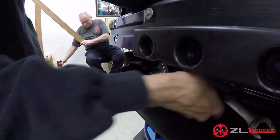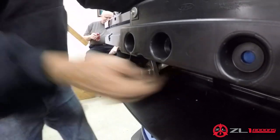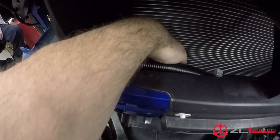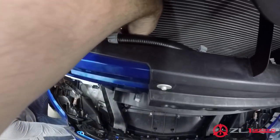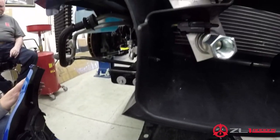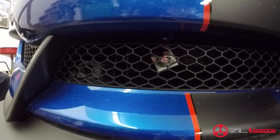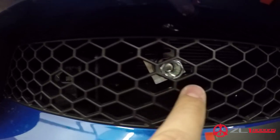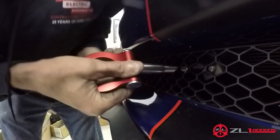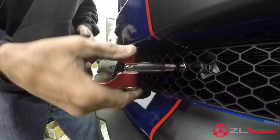You should not have to drill or cut your grille to make this fit — you just have to align it perfectly so the shaft lines up with the opening in your grille. Once our plate is in there, it's going to cover the hole the sensor mounted to; you can zip-tie it and tuck it in tight so it's not going to flop around. With the sensor back in place and the receiver in place, the front end is back on and the receiver lines right up to where you can put the shaft through the honeycomb grille.